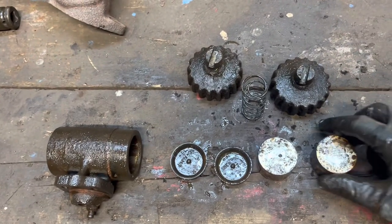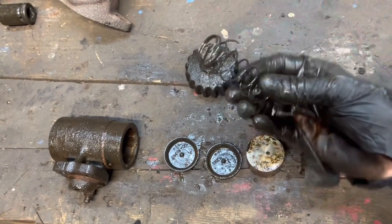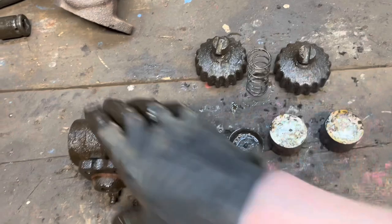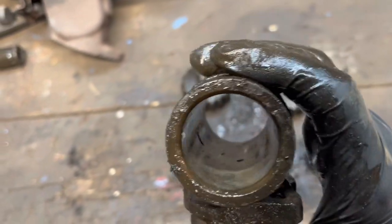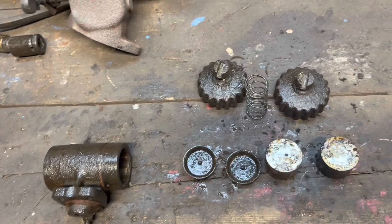And that's why the wheel cylinder is leaking and that's why there's brake fluid everywhere. So there it is laid out on the table - we've got two aluminium cups, two bits on the outside like adjusters, a big spring, and two rubbers, then the wheel cylinder itself. That's literally all you've got. It's all cleaned up - you can get a honing tool or clean it up the best you can, bang it back together, and then you get brakes again. You can get a rebuild kit if you want, whichever.